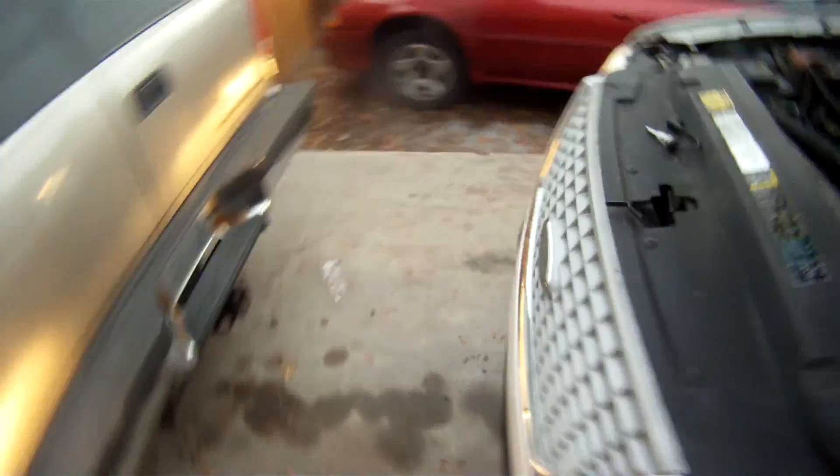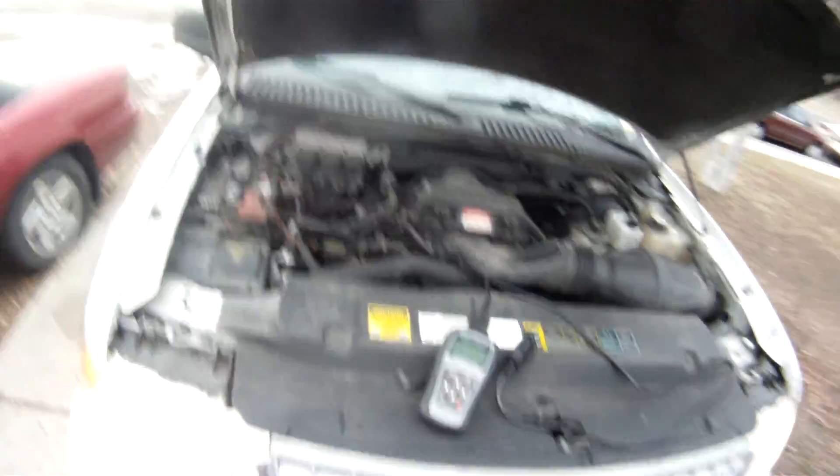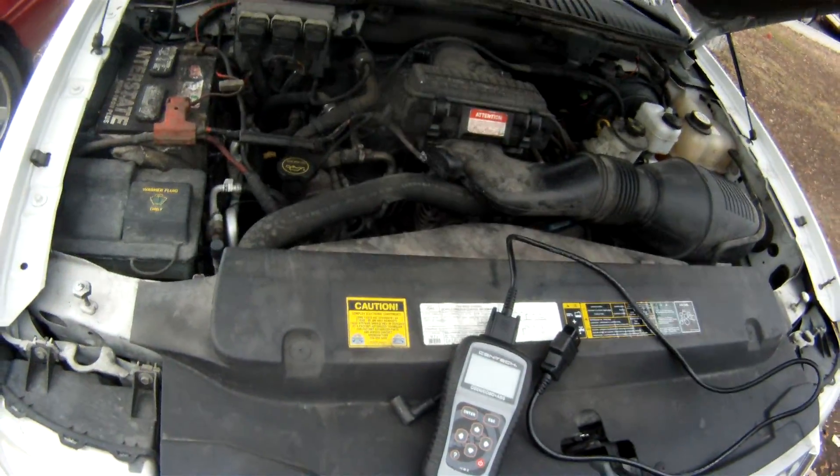Alright, so what I want to know next is what is the problem. If you know Ford, then more than likely this vehicle is going to need both a tune-up and the coil-on-plugs changed. Now I don't like this about Ford and this 5.4 liter engine — if you want to cut corners you could change just one coil and one spark plug, but that will save you money now and cause you problems in the future. Honestly the best thing to do is go ahead and change all the plugs and all the coils and go from there.